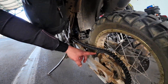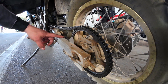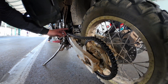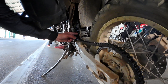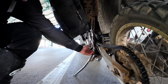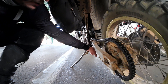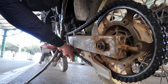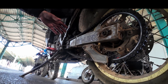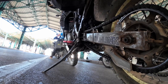The rear rim is stock. I put on a larger rear sprocket because of my next mod, which is the rear suspension. It's custom-made from Wilbers with more suspension travel and some custom-made parts to hold the spring in, so it doesn't touch the linkage which is stock below here. When fully compressed, it has about 25 or 26 centimeters of travel. That's why the chain tension has to be very, very loose. So I put on a larger rear sprocket first to go off-road.